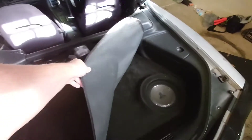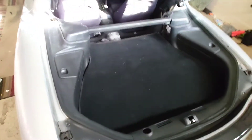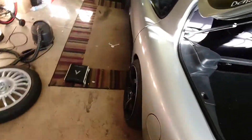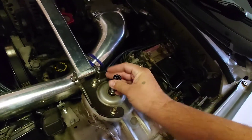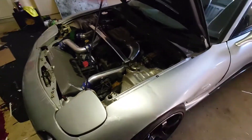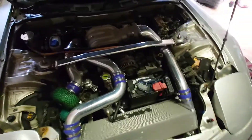I'm not sure how much the carpet will change the sound. Another thing I'm going to try is — I found my Megan Racing coilovers. This thing is way too stiff for me. I put these in and adjusted them — turned them as soft as they go just to try, and I'll make them harder from there. The backs were already pretty soft, but the fronts were uneven — one side was about 20 clicks, the other was like 8.